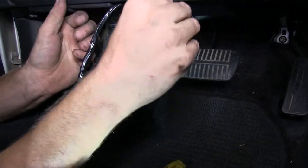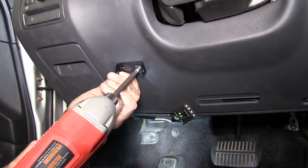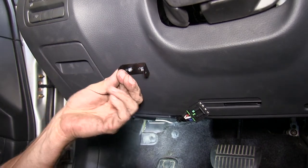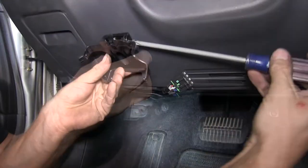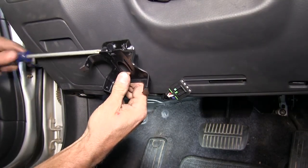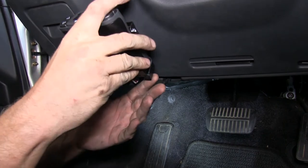While we're reinstalling the panels, we'll make sure the wire harness for our brake controller is routed to the outside. Our bracket for the brake controller is in two pieces — there's a small bracket that attaches to the dash using some sheet metal screws. Then we'll add our second part; two machine thread bolts will thread in and make their own threads into the plastic, holding everything together. We'll take our brake controller, snap it into the wiring harness, and then install it into the bracket.